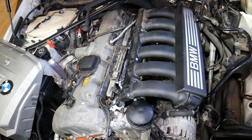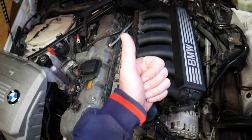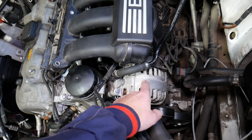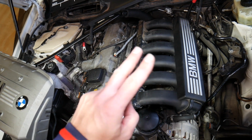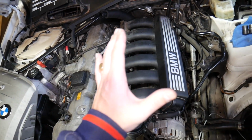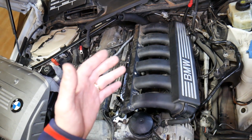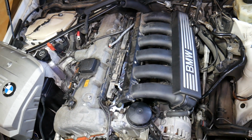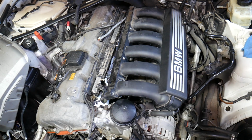So now, where is your engine starter located? Before we get to the starter, something super important: disconnect your car battery. Number one, disconnect the car battery. Why? Because the engine starter has a positive battery wire, and if you touch something you can burn your car electronics, you can damage your car computer, and cause quite a bit of damage that is expensive and hard to fix in some cases. Disconnecting the car battery without following the correct procedure can also damage your electrical system. So if you do not know which battery terminal to disconnect, positive or negative, first check out the link in the description of the video below, or just search for which battery terminal to disconnect first on our channel, and you will be able to find it.